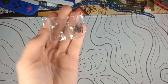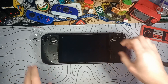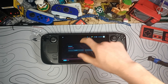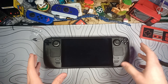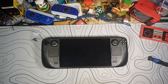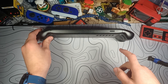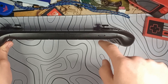Here are some brand new screws — I'm going to hold onto these. The first thing you want to do is power your Steam Deck on from sleep if it is asleep, and then just immediately shut it down. There's also a way to shut it down so it won't power on unless there's a charger plugged in, which is much safer. Once your Steam Deck is fully powered off, go ahead and pop out your microSD card if you have one. It's not optional — if you don't, you're going to break the microSD card because it is literally holding the shell in place.